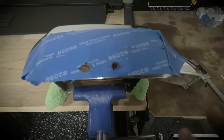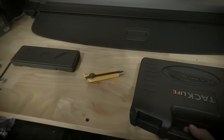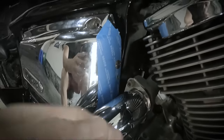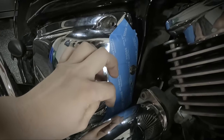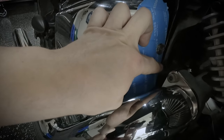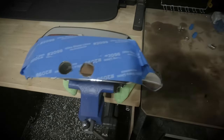I made the holes as big as three-eighths of an inch, which is just about nine millimeters, but I need to get to 16 millimeters to fit the buttons. I'm going to use the Dremel kit to widen the holes. After drilling out one hole for a test fit, the button is nicely hidden away. I'll put the kill switch on top and the starter button at the bottom, since it's close to the exhaust and I want quick access to the kill switch.